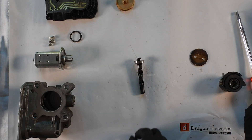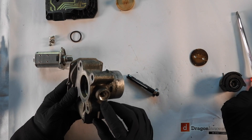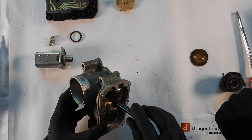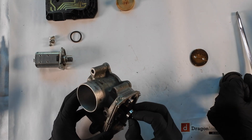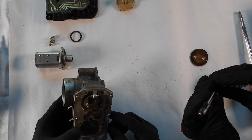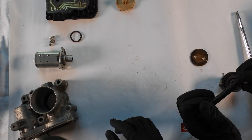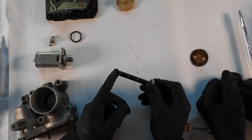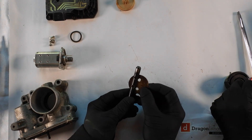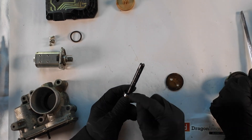Returning from the arbor press — we have this nice axis. It's a ball bearing. And on the other side they didn't put a ball bearing; it's just a bushing. So it's well guided here and just a bushing on the inside — it's not really spinning, just rotating a bit. There's a lead-in to help it find its way. And I wonder where they slotted it — that slot for the throttle plate clamp looks like it was done with a saw as opposed to an end mill, because I can see a little radius back there. I would say that's a saw cut — not ground, not a cutoff, too thin to be a break-off.